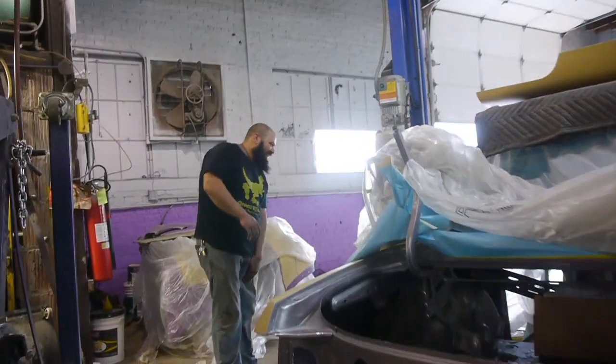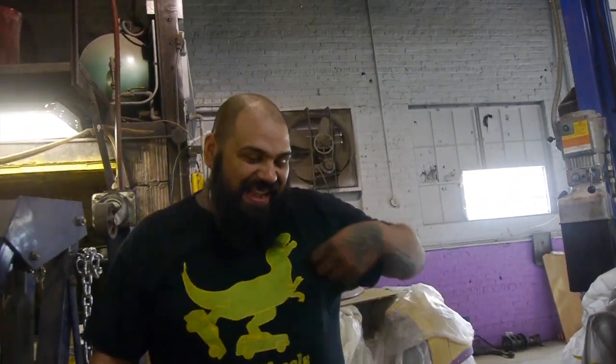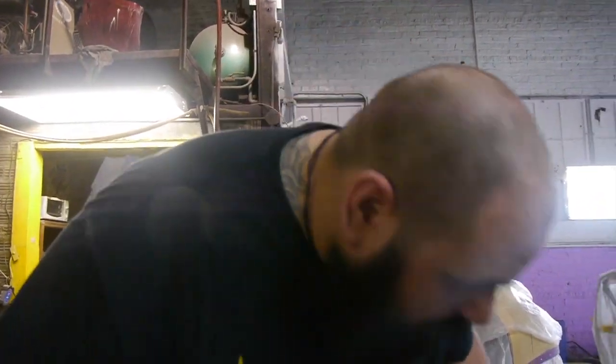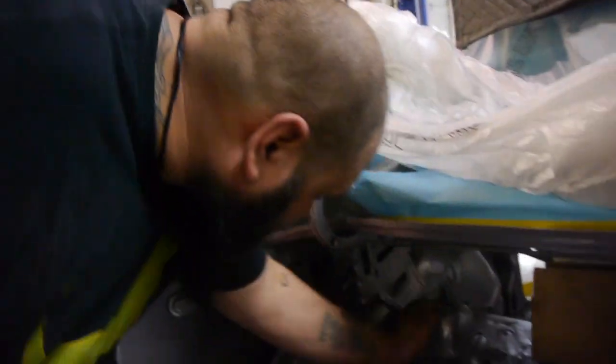Tell me about it. How long has it been up? I want to say about 3 months. Took me about a month to do that rear IRS, kind of gut it out, take off all those rubber bushings, and we ran into some issues getting some of the kits that we needed to press in those axle bearings to the knuckles. So it's been up here about 3 months, and it's good to see it hit the ground because now we can roll it around, get ready for paint.